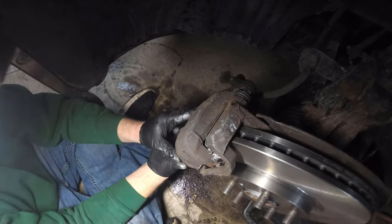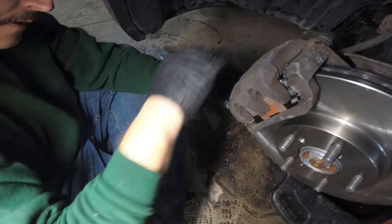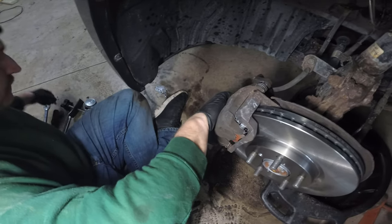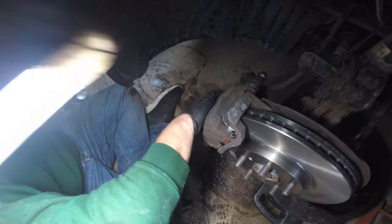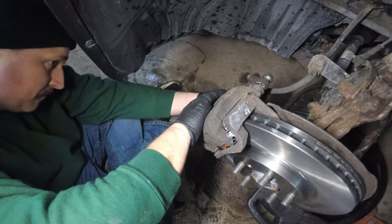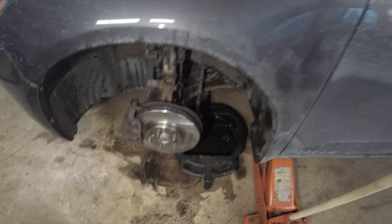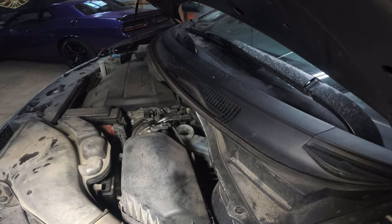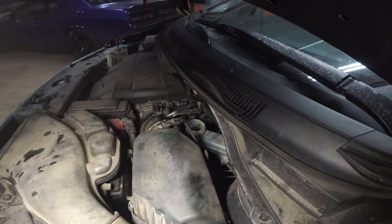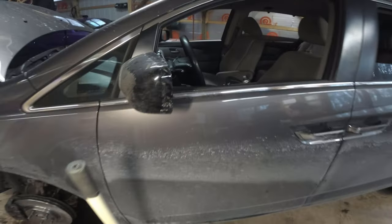Make sure you push in the caliper pin boots. Put the caliper on usually from the bottom first, then clamshell to the top. With that in place, add the bolts back in — you may need the 19 millimeter wrench on the backside to hold that nut while tightening. Put your wheel back on and torque it down to 100 foot-pounds. Continue flushing the brake system as discussed. Once all done, put the top back on your brake fluid canister, start the vehicle, leave it in park, and pump your brakes until you feel pressure — at that point you should be good to drive.